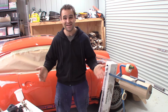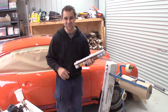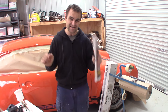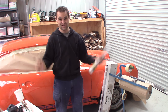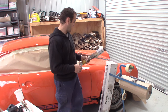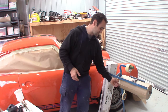The next things you're going to need is some form of masking material. Most guys starting out use just the old newspaper. I'm not a huge fan of newspaper, mostly because there are often little holes from staples, or sometimes holes around the edges, and it's easy to miss those holes. You get overspray where you don't want it, and it's really annoying. That's the first way to go though — the old newspaper.